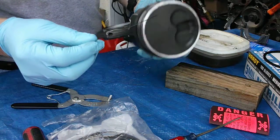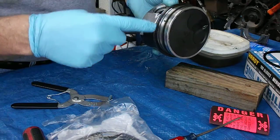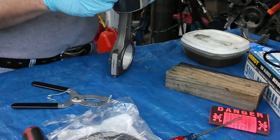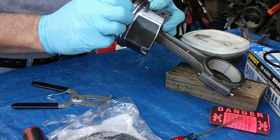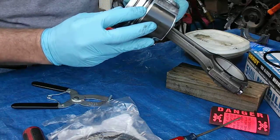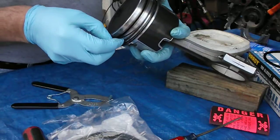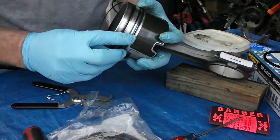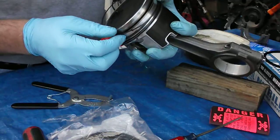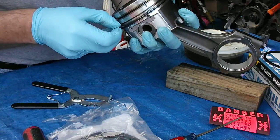The trick I found is: wherever this gap is, put this on the opposite side. It goes on the bottom side in this application. You just want to work this little thin ring all the way around on the bottom side. You can just stick that in the bottom right there, and there's enough play in this thing because it's so flexible that you can work it around. It seems to be a whole bunch quicker than trying to install it all as one piece and then sliding the ring around to get it in position.